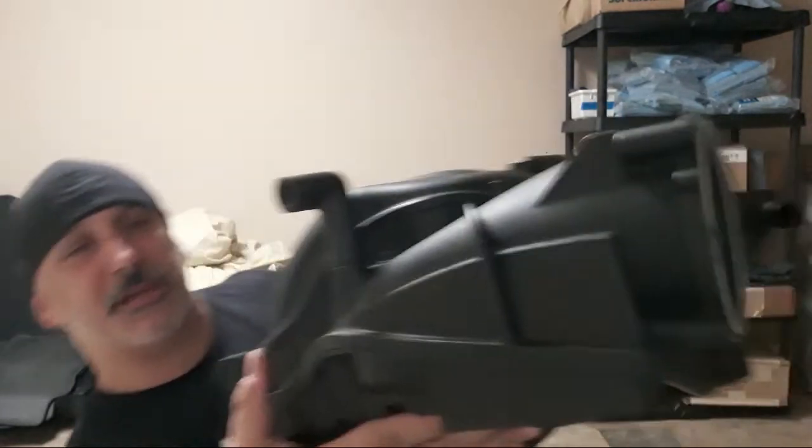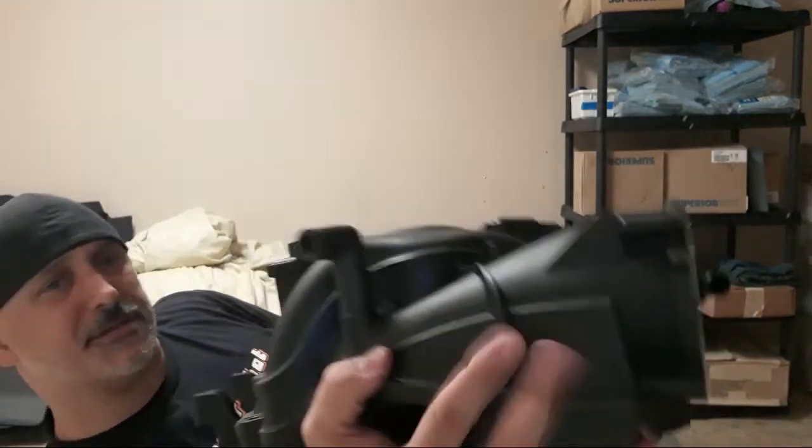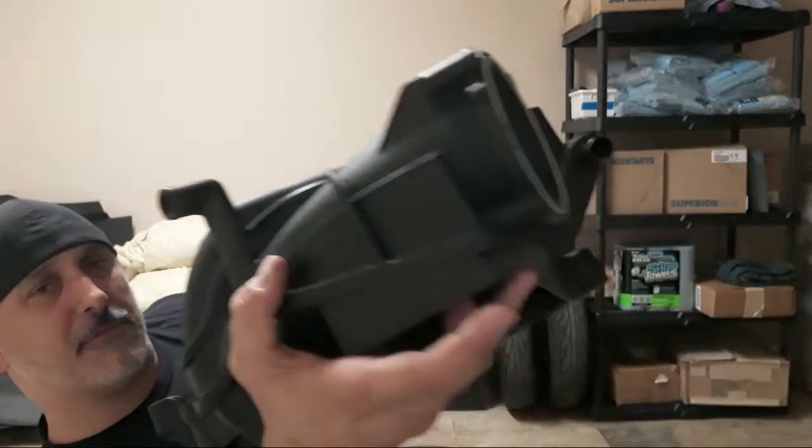Now, to that point, which throttle body do I recommend? No bigger than an 85 millimeter, primarily because of the throat area that I just showed you guys earlier, the way that it sets and the way that it drops down. It actually pinches. See right there where it drops down right after that boss right here, and right up underneath here, it actually pinches down.